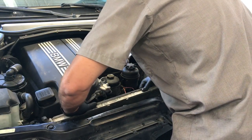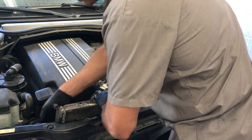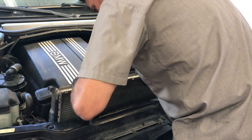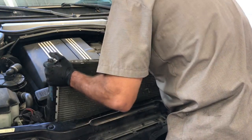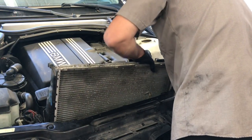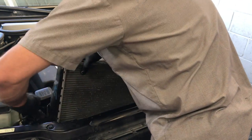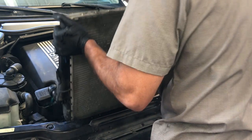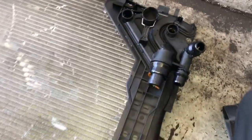This is a brand new bottle installed a few weeks ago — the customer is doing these repairs in stages. Now push the radiator towards the belts and then pull upwards, starting to pull it out of the car. You'll have to push the wiring off to the side and on the driver's side the hoses for the coolers may snag — push it left and right and then lift the radiator up and out of the car. When you get it out it'll come out as one piece.